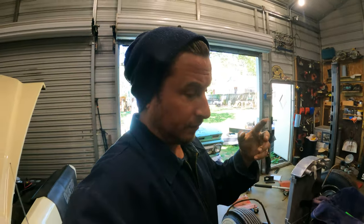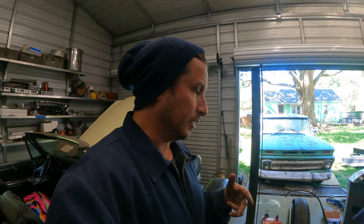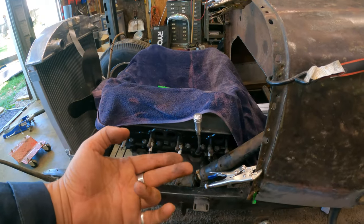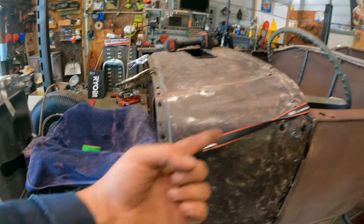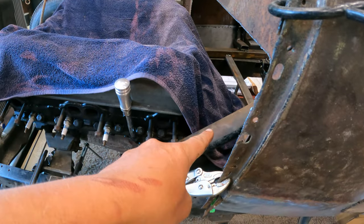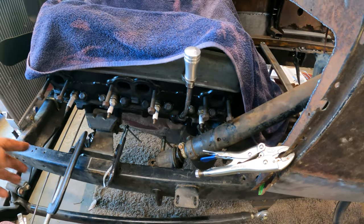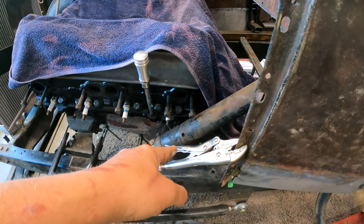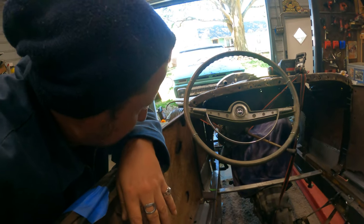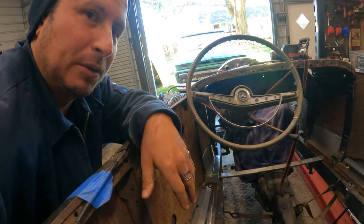If we do the fancy, like too many U-joint steering, and we do it correctly, it would actually technically be kind of safer, because right now, if this thing crumples up, that becomes a jousting lance to stab you right there. If you have your steering run down and then turn 90, if this thing starts to fold, that steering knuckle will just break.